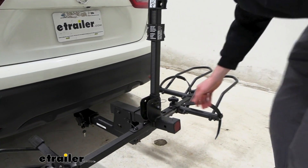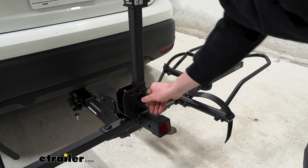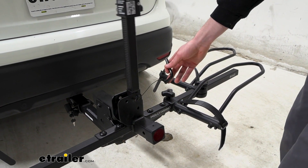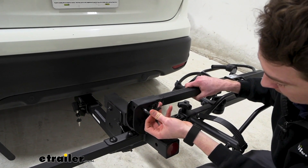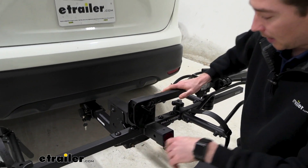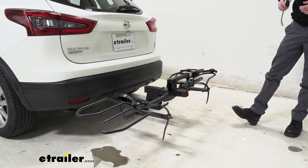To get the center mast folded down, we're first going to have to pull this pin. There is a notch that lines up with the corresponding hole. Fold it down, and then we'll have to find this top one — again, it has that notch that you have to line up to get all the way through. And now it's secure, and we can get a couple of measurements to see what it's like to add this on to the back of your vehicle.